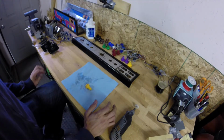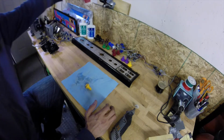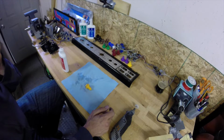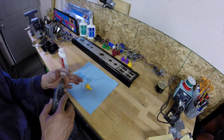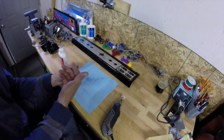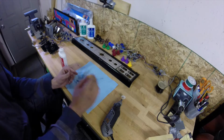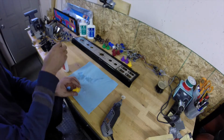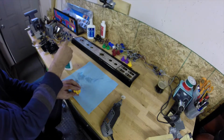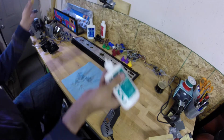If you're using polishing compounds, rubbing compounds, things like that, you want to make sure that it stays wet. If it doesn't, you get the chance of actually creating burns. This can heat up so much against the surface here that you can actually burn, even melt the plastic if it gets hot enough. So, keep the speed low, keep the moisture high. Actually, we did start with a 3, not with a 2. And this is going to splatter kind of all over the place.